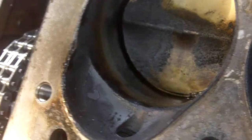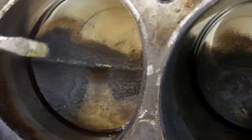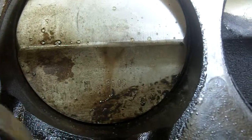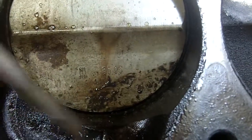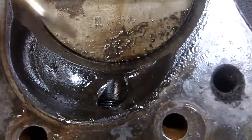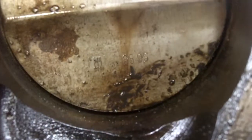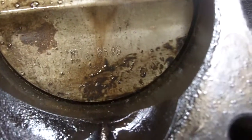First off, we can see how the tops of the pistons have lots of clean spots and lots of carbon spots. This one is particularly dirtier. This one here is nice and steam cleaned and has almost no buildup on it, and is wet in the part of the combustion chamber. As far as the miracle of water injection — this was also the cylinder that, when we were taking it apart, had the wet fuel injector and the wet spark plug, even though it hasn't run in many days.